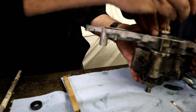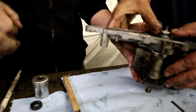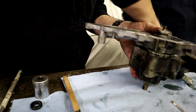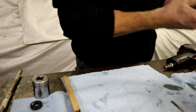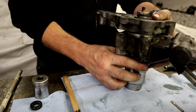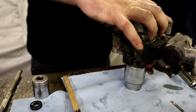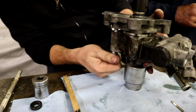Oh, is that another seal here? There's another seal there. So with that little space that I saw in here, when we push this down, oh, okay, that's going on the shaft now. Okay, and then I'm gonna put this on something like this. You guys don't want to hammer directly on the shaft. You could probably knock everything back out as well. Okay, so everything looks like it's lined up. I'm gonna put these bolts in there just to keep us. Perfect, that's a great idea.